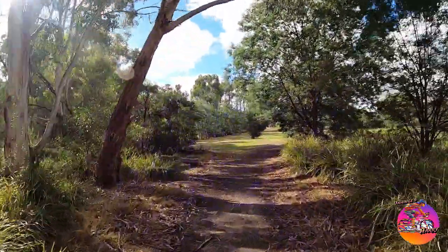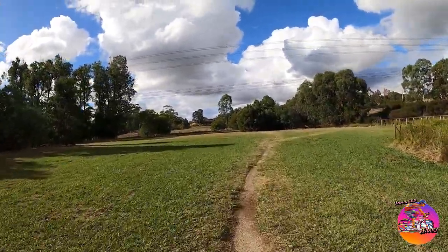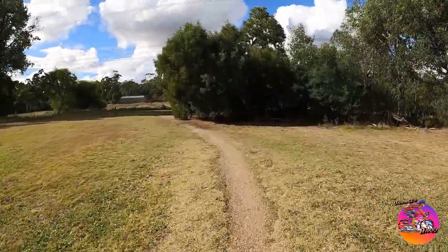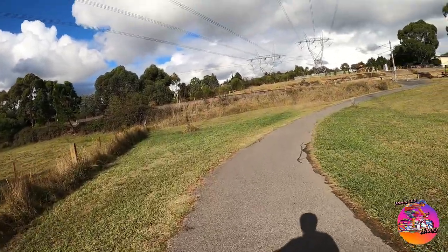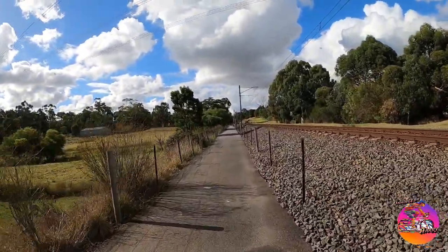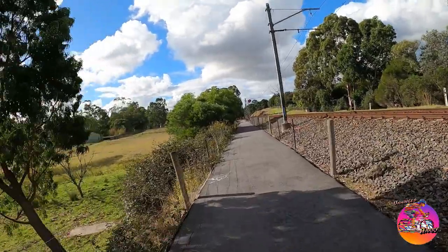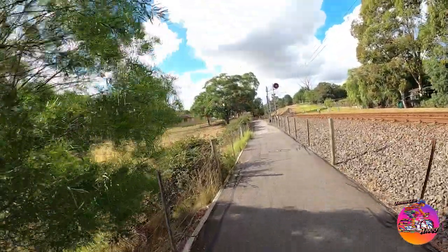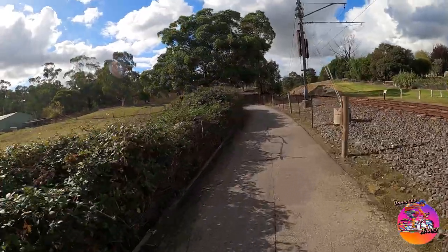That noise I'm pretty sure is the rear freewheel because the frequency of it — the cadence — is more than the cranks. If I make a certain noise and I stop pedaling for a moment then start again, the noise changes. It's a Shimano one on the back now. I had a Dicta — D-I-C-T-A — once and it was a similar sort of noise but a lot worse, like a cluggy cluggy cluggy.